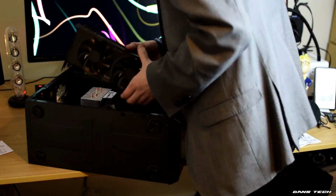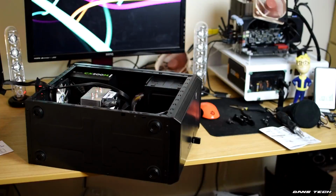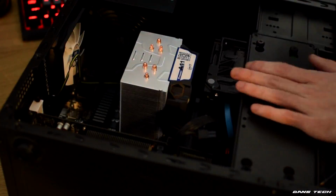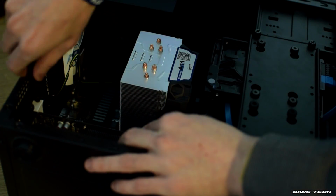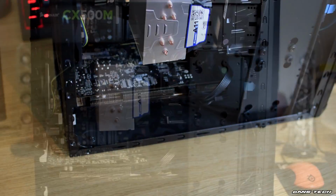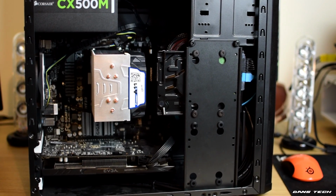Also keep in mind that using more fans in the case will generally give you better noise levels if they are lower spinning fans. More fans does not typically mean more noise as long as they are quiet fans. Be sure to check the specs of a fan on the manufacturer's website and seek out the RPM and the amount of noise that the fan makes in decibels before going out and purchasing them on, say, Amazon, just because they say quiet in the title.